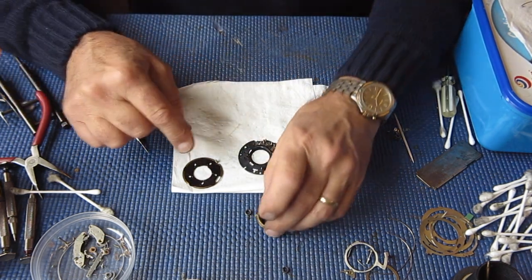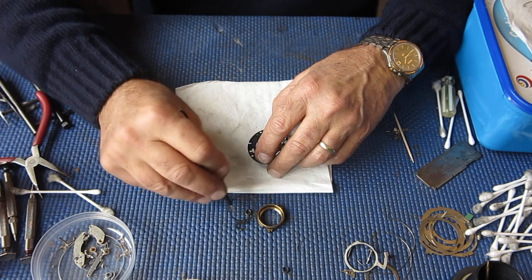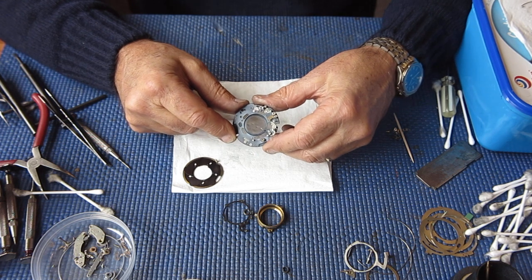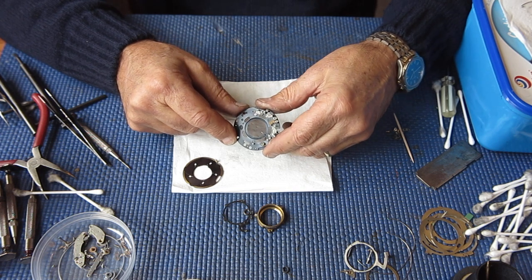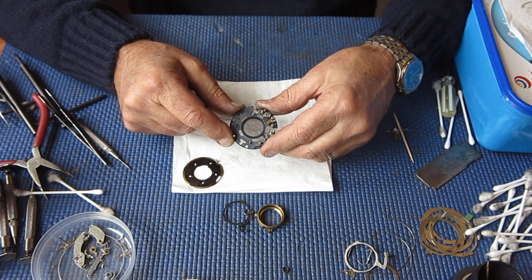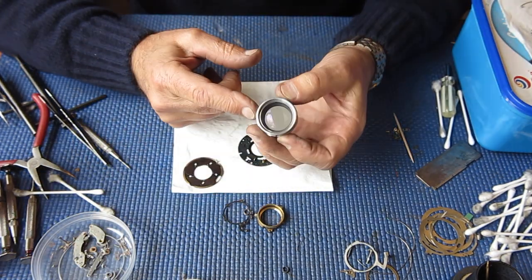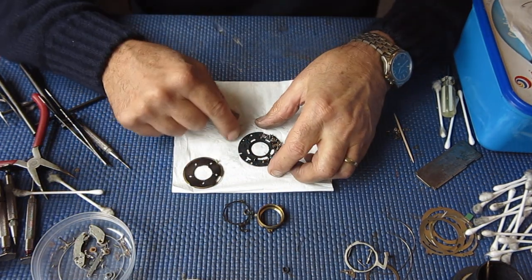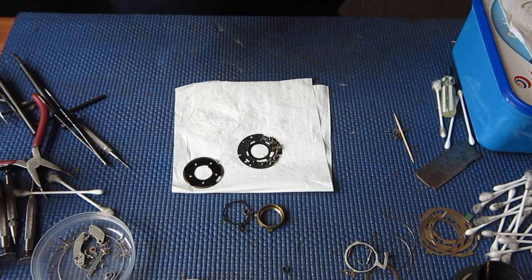As I've said, almost certainly the cause of the problem will be that the camera's been dropped on its nose, crushing the shutter effectively. Often there is no obvious sign on the outside of the camera that that has happened, and it's because the camera was probably in its leather case at the time. And failing that, the camera was not in its leather case, but it was dropped on a carpeted floor. And so often it leaves no marks on the lens at all, nothing to suggest that there'd been a problem. But a problem has certainly been there, and a problem was left behind.